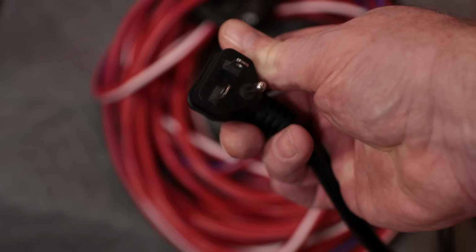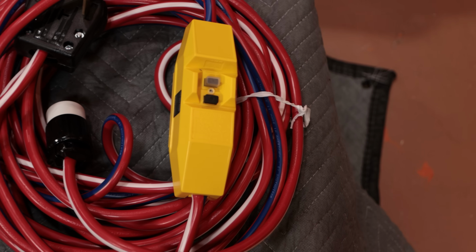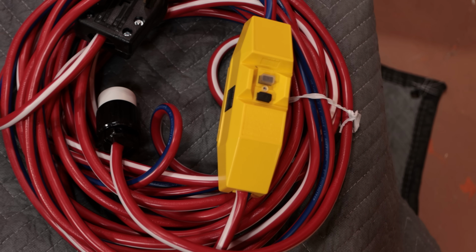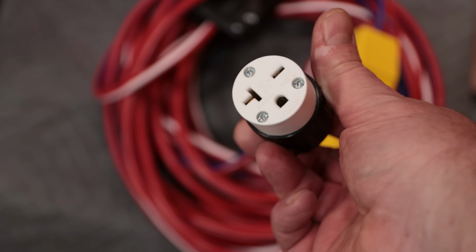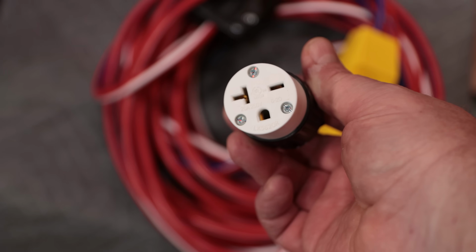Now for power consumption, this has a NEMA 6-20P plug, so it is a 20 amp rated unit. The good thing about that is, if you have a 10.5 that you're running on 240 volts, and you built one of my extension cords with the GFCI built into it, and I'll leave a link up here and down in the description for the extension cord, the only real thing you have to do is change out the end of the cord and put the 6-20P plug on it, and it will run fine.